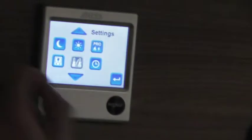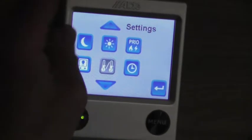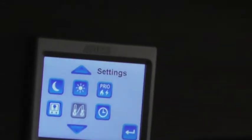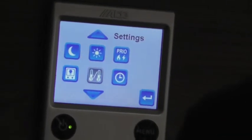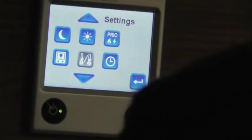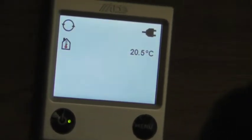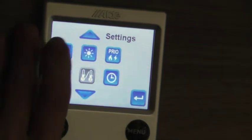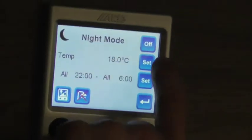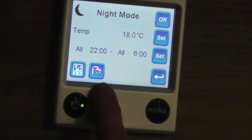You've got a couple of timers - two or three actually. There's a reduce temperature timer for night time if you don't like it too hot. Normally during the day you'll have it at a certain temperature; night time sometimes you'll have it cooler. You can set a timer to run from, say, ten o'clock at night to seven o'clock in the morning on a lower setting. It won't drop down to that temperature instantly - you do that naturally. Over that period of time it remains at that temperature, then in the morning the timer comes off and it reverts back to your daytime setting. You can also switch water heating off during that period if you want.